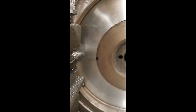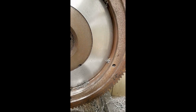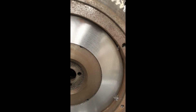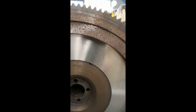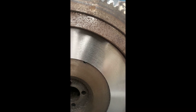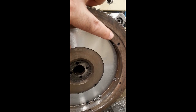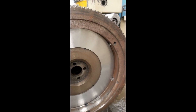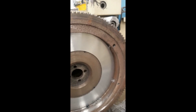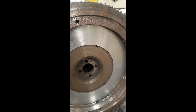You can see there are no more hard spots left on the flywheel. I had to take a total of 0.7 mm off the surface for it to clean up, and then I took another 0.2 mm finishing cut just to get it nice and neat and ready to use. Next step is the clutch mounting surface — the pressure plate mounting surface. I'm going to cut that to the right size, the OEM spec, so that the pressure plate works with the correct pressure as per the new friction surface which I've moved in slightly.